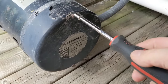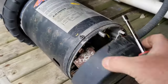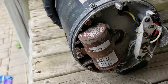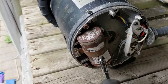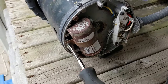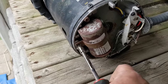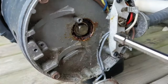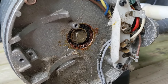We're going to remove the two screws in the back — this one here and this one here. The capacitor looks in bad shape. I'll link down below how to test the capacitor. I can almost guarantee it's this. For this pump, that bearing looks pretty bad too in the back — the back bearing looks like it's in rough shape.